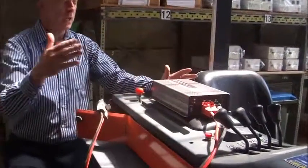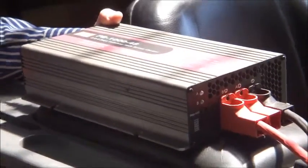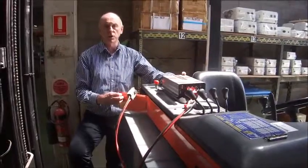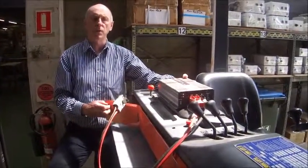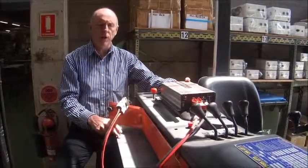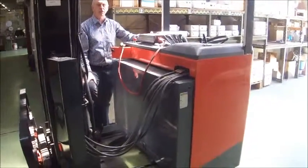It's fully automatic with full overload and short-circuit protection. It's very simple, very small, runs very cool, and is extremely efficient at charging. Most importantly, it's very good at refurbishing the battery and bringing the quality of charge up to a higher level. This charger will charge this big battery much better than a conventional three-phase charger — you end up with a better state of charge, the SOC.